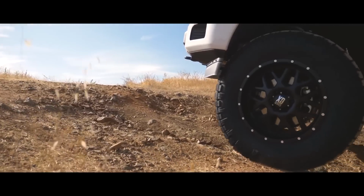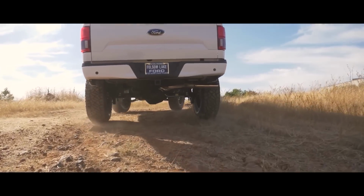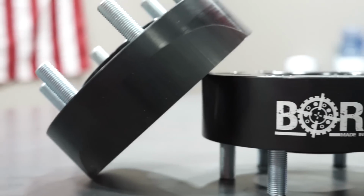The track width that I'm talking about, if you're not familiar with that, is how far the lift kit pushes the wheels out in simple terms. Most large lift kits will increase this anywhere from 1 inch to 1 3/4 inches per side on the front, but there's no change in the rear. So what people do most often to combat that is just slap some spacers on the rear.